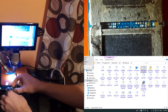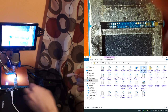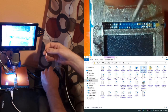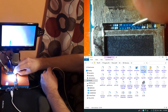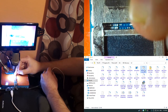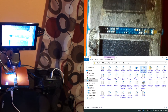With the computer in test mode and drivers installed, connect the USB cable to the phone first before attempting the next step. Using your right hand, hold a needle and gently press it against the metal shield, then poke the needle into pad TP6005, effectively jumping the pad to ground. At the same time, with your left hand, connect the USB cable to the PC. If the PC makes a connection sound, we are good to go — otherwise, try again.